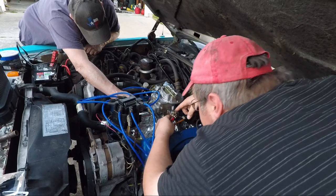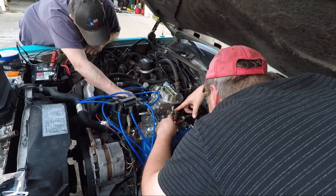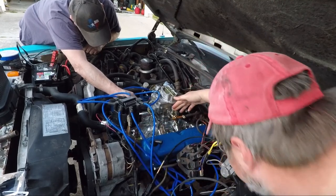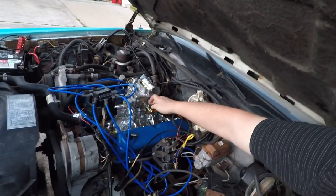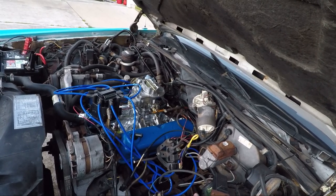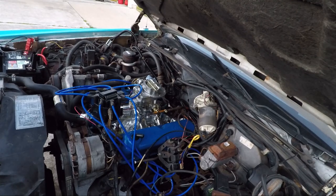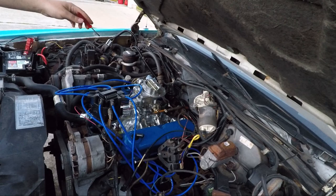I don't know if there's a way that you adjust this guy, but he really seems to be kicking up that rev. Yeah. And I think maybe if I just hold it like this, it won't be so insane. Well, does that sound lower? I mean, it's up there in the rev-ems. Derek would love this car. Because the only thing that it could be to me is too much fuel at this point. Because obviously the distributor's working. Obviously there's fuel getting in there.